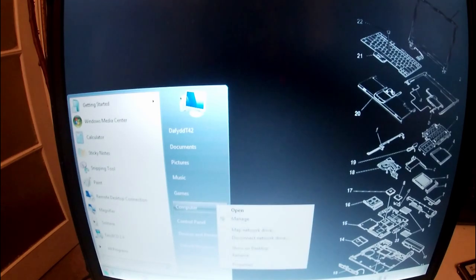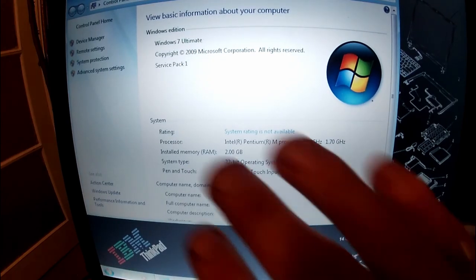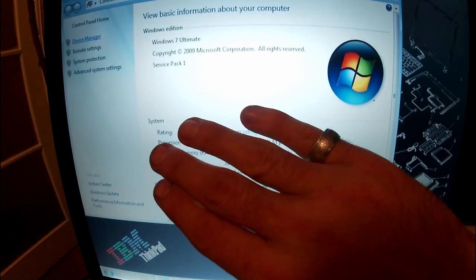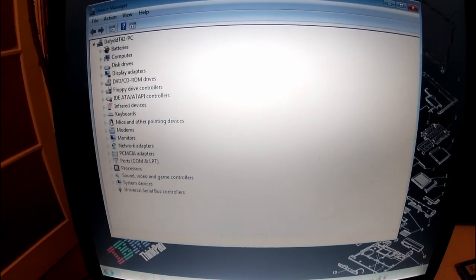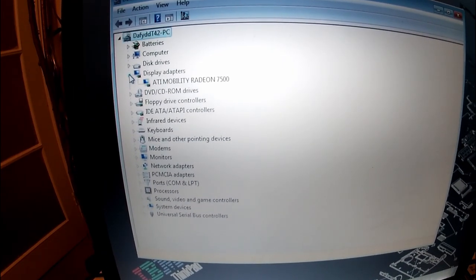And again, I need my computer. Going to just show you all the drivers installed, and then we're going to go through how we did that. Let's cover that up quickly and go to Device Manager. So as you can see, we've got a fully populated list of non-errors. This one, getting the right driver from Snappy Driver, took a few attempts, but there's three drivers on there basically. The second driver works for XP and the first driver works for Windows 7. So that's basically what we're aiming to do here today.